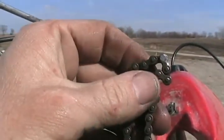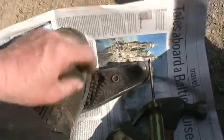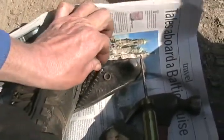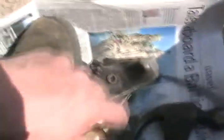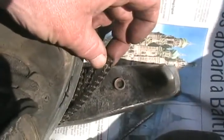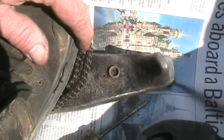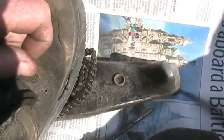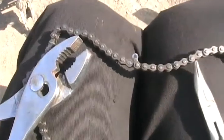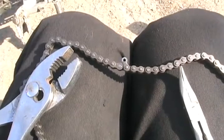Now I've done the same thing to the new chain. Now I've set the chain on that thick washer, just right across the opening, and I just took the point of a screwdriver and a hammer and pounded the little pin until it's recessed. Now I just pry and swing that little figure-eight shape thing over - so it's done. I just used those two pairs of pliers and moved it over by hand, no problem. Now just to separate the chain.